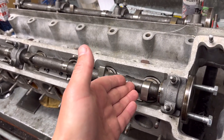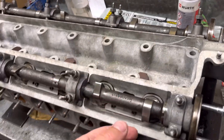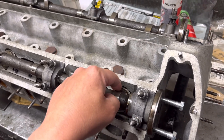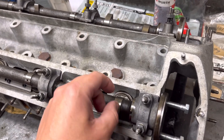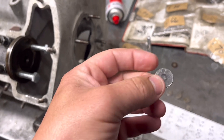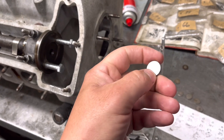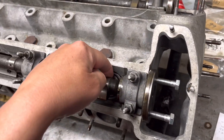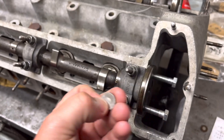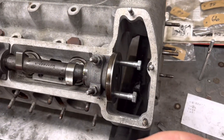Then you've got the solid lifter type where you have a clearance to set — say six thou on the inlet, eight on the exhaust. You've either got a solid bucket with no shim in it, or some have a big shim that sits in the top of the bucket. Others have this type where you've got a recess in the spring top that holds the valve in, and these shims just sit in that recess. There's a little pip at the base underneath the bucket which sits on top of the shim, and by adjusting these shims is how you get your clearance either tighter or slacker.